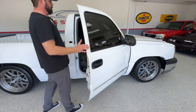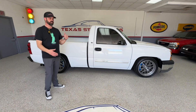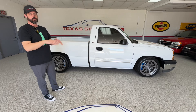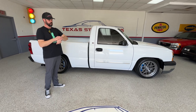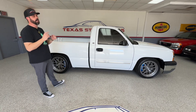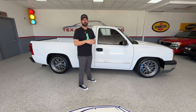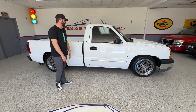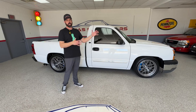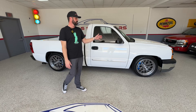Mr. G's wrapped up all the suspension. We ended up rolling the rear fenders to get a little clearance for the 315s — going in and out of inclined areas it wasn't rubbing on hidden dips but going in a driveway there was a little rub, so we rolled those. We're heading to Lone Star in a couple hours, so if you're in Conroe this weekend come check it out. We're also hoping to wrap up Jason's dually soon — waiting on the wheels. Very happy with the end product — this is the first round of stuff, and we may do a power adder or some interior upgrades next.